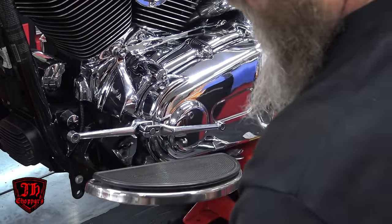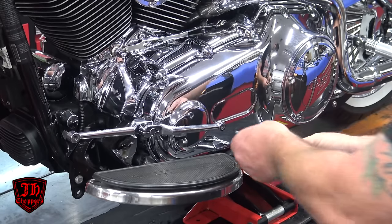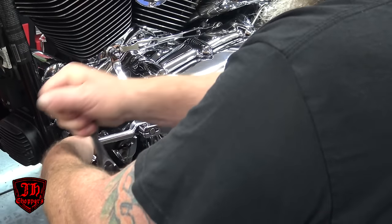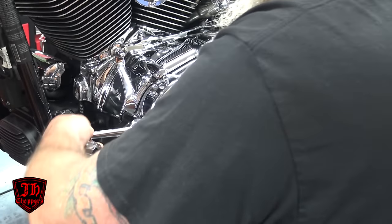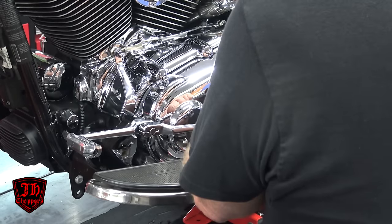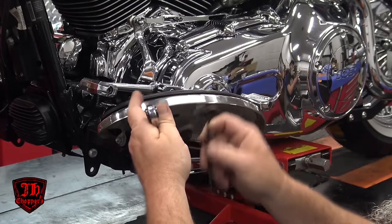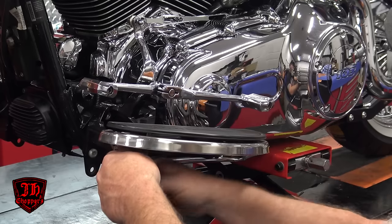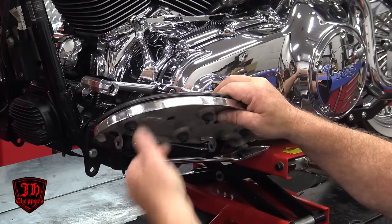The first thing we want to do is get these shifters out of the way — they're a quarter inch. A lot of times from the factory they'll have some red Loctite on there, which I think is a little bit overkill. Blue Loctite will do just the same. Loosen and get these out of the way. Yeah, there it is — some red Loctite on there. I'm going to take our new bolt, go ahead and put it through the shifter, apply some blue Loctite. I don't like to start these with any kind of ratchet — go ahead and start them by hand to make sure we don't cross thread them. When we get to that last turn, put the shifter about where we think it should be — slightly tilted. For me, I don't like them flat. Same with the rear — slightly tilted towards my foot.